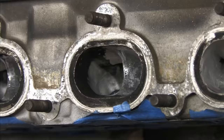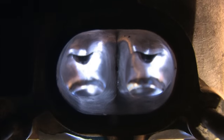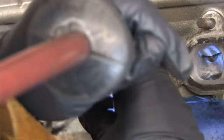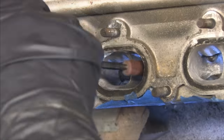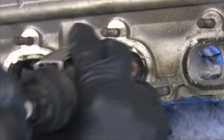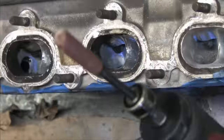This is the way I'm going to improve flow capacity without making drastic changes to the diameter of the exhaust ports. Slimming the divider strategically lets me increase the port volume without losing much along the lines of exhaust gas velocity. It's a subtle change that gradually increases just past the bowls, and aside from the small area in front of the divider, that's where all my port shaping ends. So there you go, there's the whole unabridged Hyundai port job secret. The cat's out of the bag.